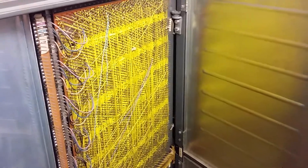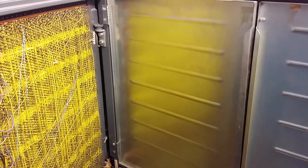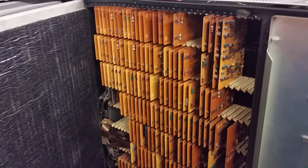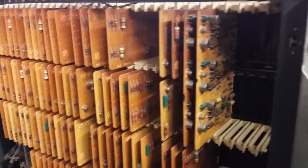Let's look at an IBM 2821 control unit — we're looking at the backplane now. The 2821 was a control unit used mostly to control the rather famous 1403 line printer. This was a gigantic printer, probably the best printer of the 1960s, and people used them forever — a very good printer. The printer itself was pretty dumb, so you needed this big blue box. Even though it is System 360-era stuff, they used the older technology called SMS — you can see all the discrete transistors.